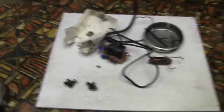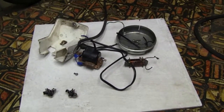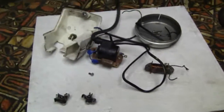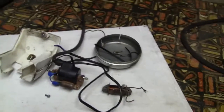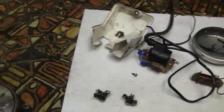In the end I decided to strip all of that out — strip out the entire points system. I got rid of the ignition source coil which goes in the generator, the ignition coil which steps the voltage up to the spark plug, and the inside cover. I didn't need those anymore.